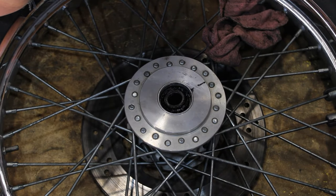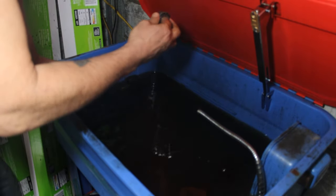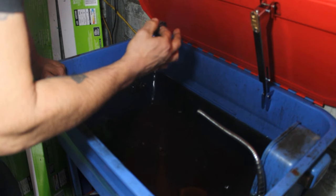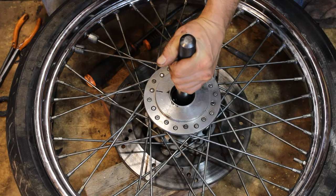This bearing is fine — I'm just going to clean it up, repack it, and continue using it. There's no need to replace something that's not damaged. Let's go take a look at the race and inspect the rollers in the light. In the light you can see this bearing was about to fail, and I got lucky that I was putting a tire on. Following the service manual — checking end play and bearing roughness — let's drive out the old race, put in a new one, readjust the end play, and get this done.